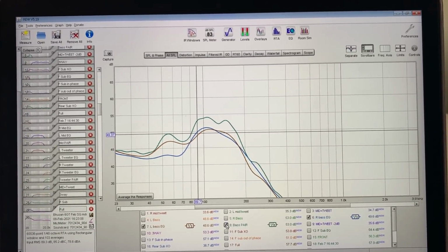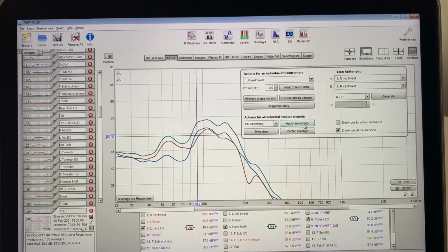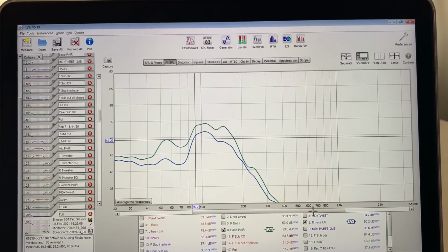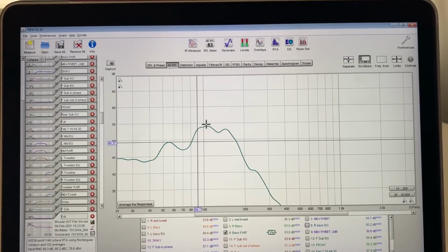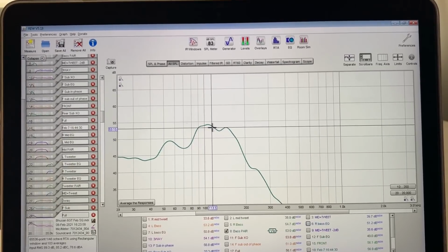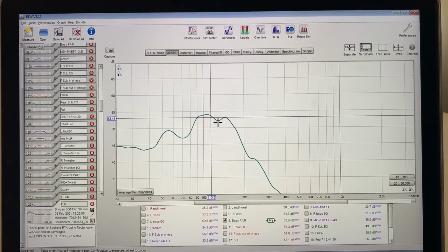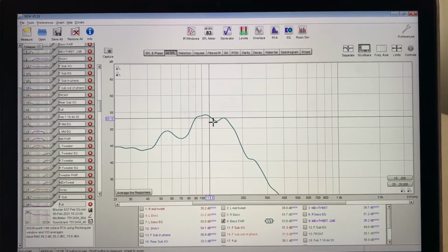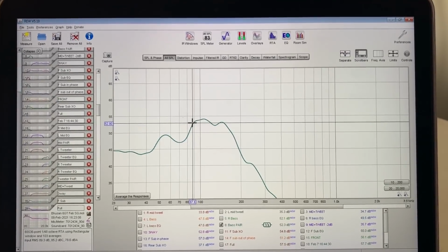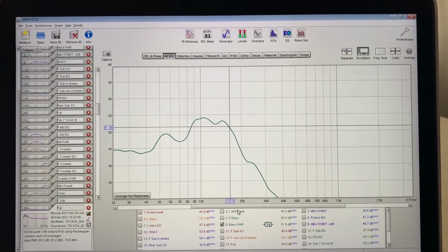So from that, I had the bass pair. Hang on, let's put a 1/6 smoothing on it. That was the mid bass pair. And as I showed on the single pieces as well, where we had an acoustical problem between 120 and 150, it shows up on the pair as well. You just can't push enough EQ into it. There's no point bringing back something that's acoustically close to a null point or problematic area. But it's pretty functional now between 80 and 170 with 24 dB slopes.